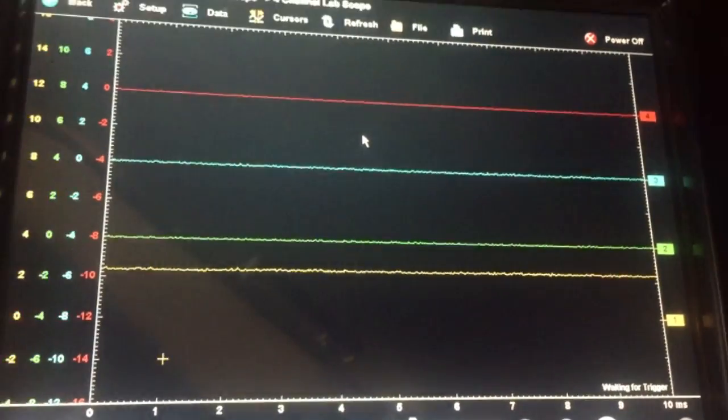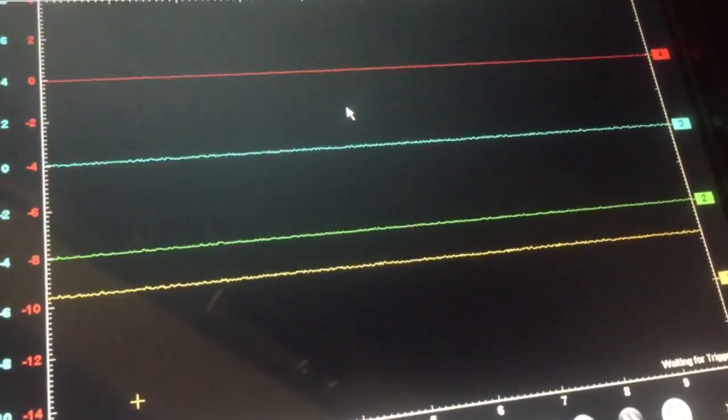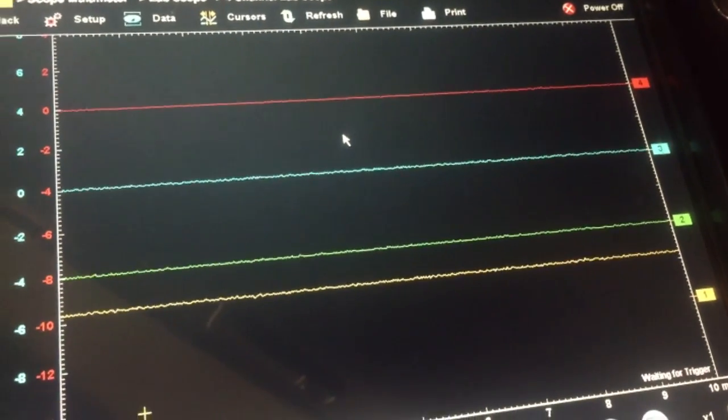On rare occasions, the HVAC panel can be the cause. So you just want to make sure you're getting the right signal to your power transistor. In this case, the signal was good, and the power transistor was at fault.